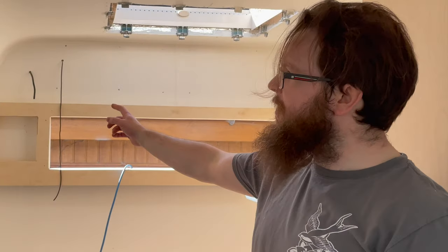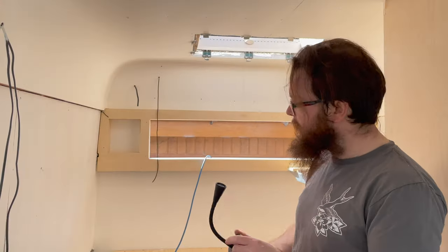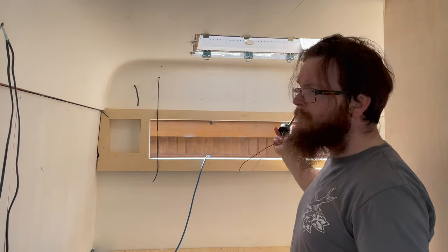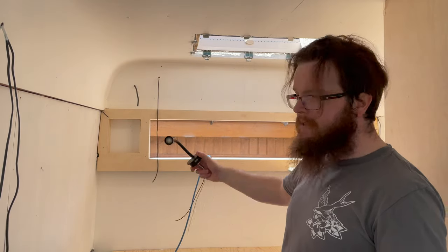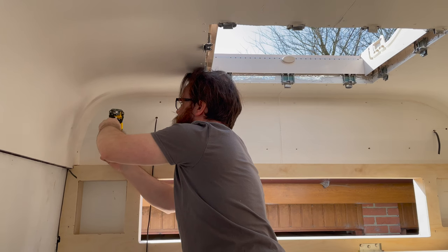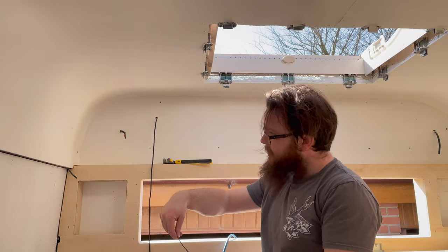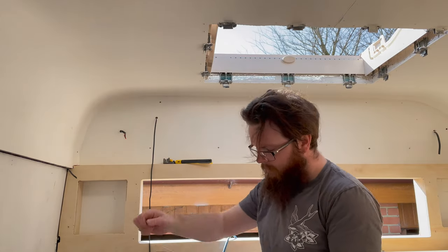The Osmo is drying and I've cut a dowel for the storage as well. I'm going to crack on with some electrics and come back to this with finishing touches at the end. The little reading lights we've gone for — we're also going to have other lights in the bedroom like these little flexible LEDs: they're dimmable and most importantly they've got a USB charger in them. We've wired the one in the bunk and the one above this side of the bed in parallel so they're running off the same circuit. I'm just going to chop some of the tail off.